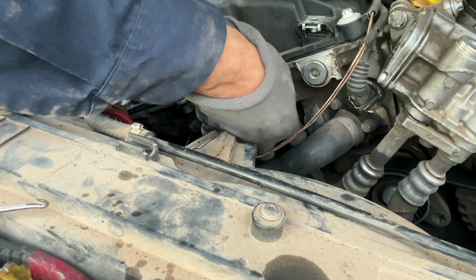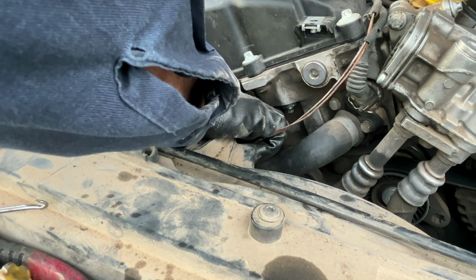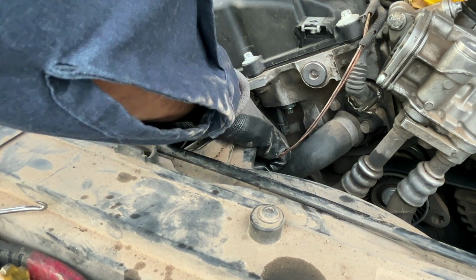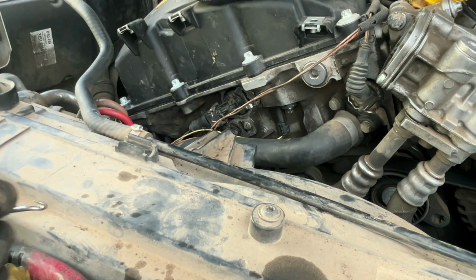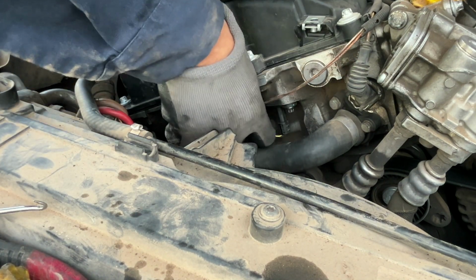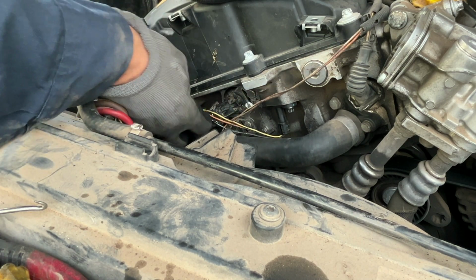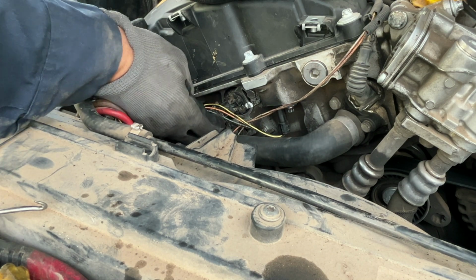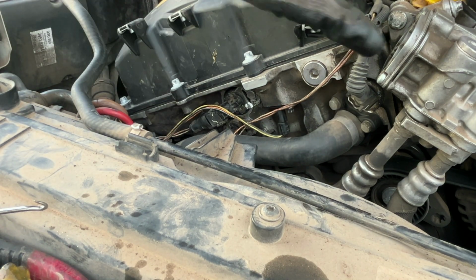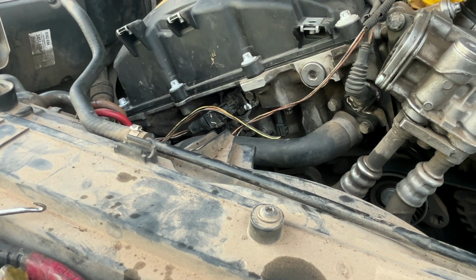They're good. I don't want that wire touching the engine, because I don't want to burn them wires, real thin wires. Put it up on top of that hole. Maybe I'll put some plastic on it later. Make sure that it doesn't touch anything hot. All right. First, I'm gonna start it here in a little bit. I'm gonna put everything back together.